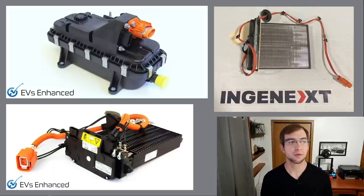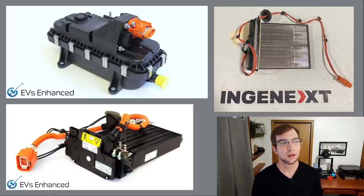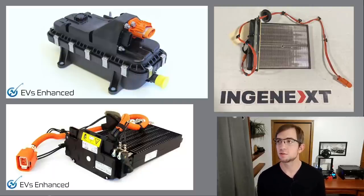Here we have three examples. Top left is from a 2011 Nissan Leaf — it is mounted under the hood and heats up coolant, which is then passed to the heater core where the heat is transferred to the cabin air. The Chevy Bolt has two heaters like this, as we will see shortly. A disadvantage of this approach is that it takes almost as long as an ICE vehicle to warm up and provide heat, since all the coolant must be heated before the cabin air can be heated. The bottom left is from a 2013 and up Nissan Leaf — instead of heating coolant, it heats the air directly, which provides heat a lot faster. The top right is from the Model 3 before it got the Octavalve system, and it works the same as the Leaf's below, only split into two sections to provide different temperatures for driver and passenger.